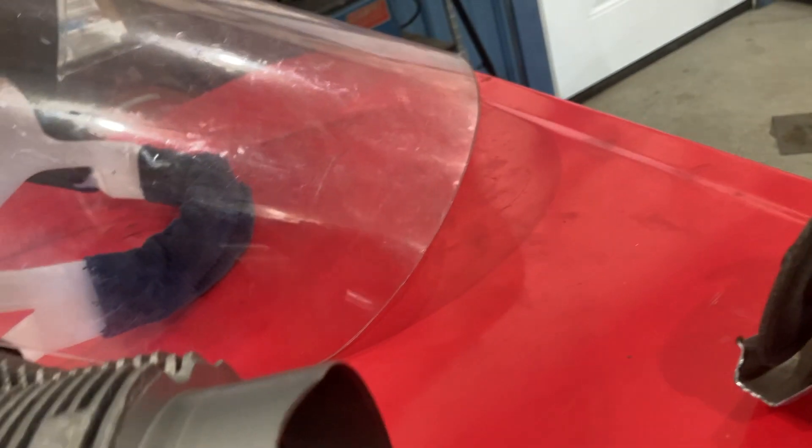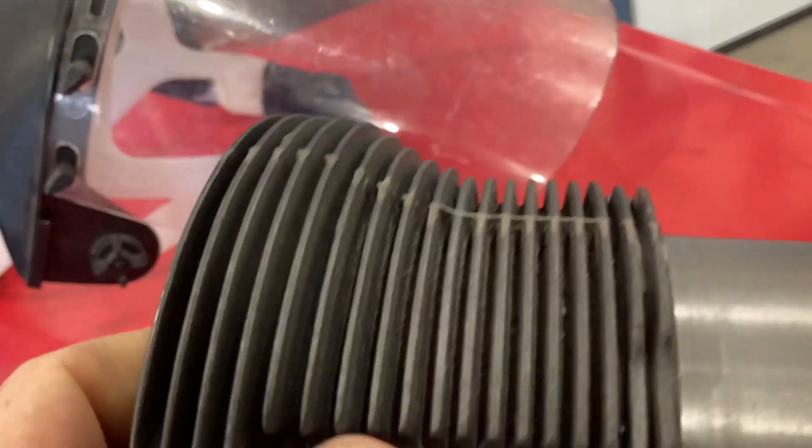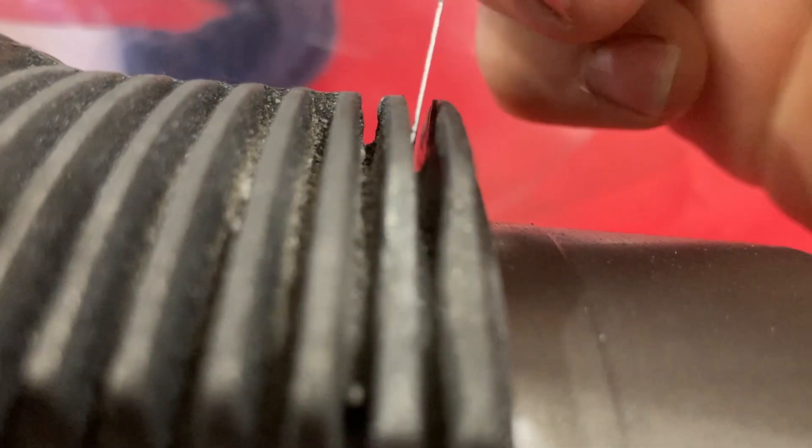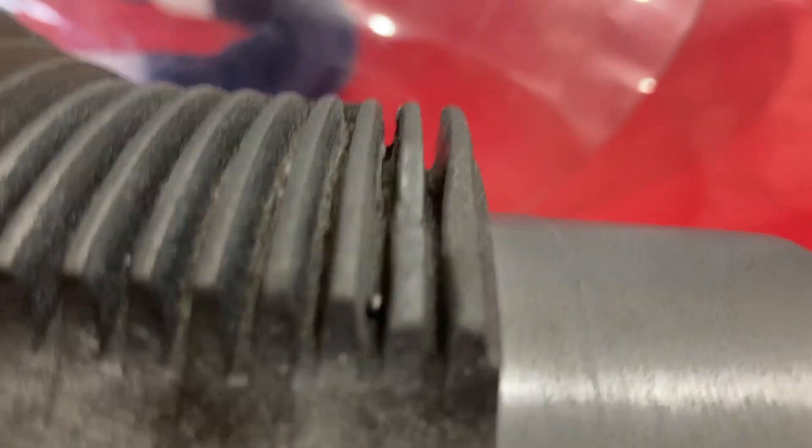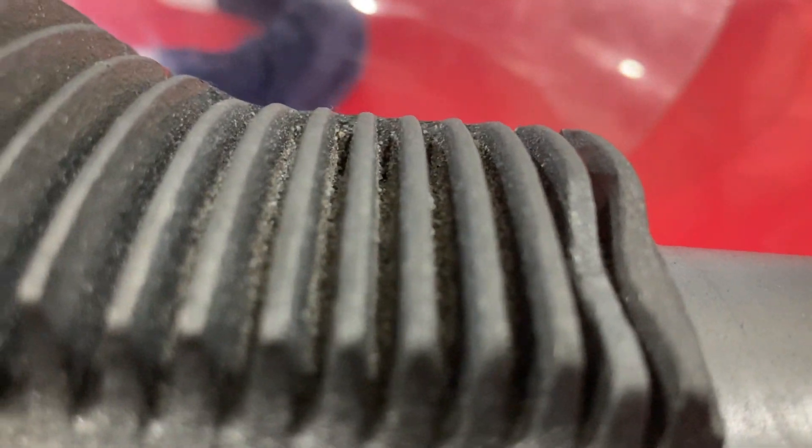Let's go to the other side — this would be the bottom of the cylinder. This side is even worse. Look at that — it's completely blocked. I have already gone in with the air grinder and opened this one up because this one was blocked about midway up. I'm actually going to do a little bit more just to smooth this out, and I'm going to go all the way up and knock every one of those down because it is blocking here.